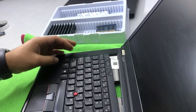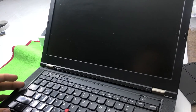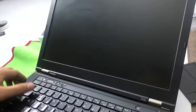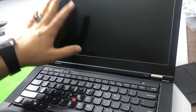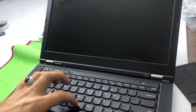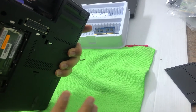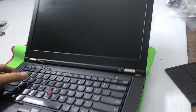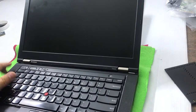I'll put this RAM back. Technically this laptop currently has 4GB of RAM. If you already know you have 4GB in your system — for example you checked the configuration menu — you don't need to remove the keyboard to inspect the second slot. If there's no stick in the exposed slot and the system shows 4GB, then 100% the RAM is under the keyboard. Just open the back panel, insert a 4GB stick in the visible slot, and you'll have 8GB total.